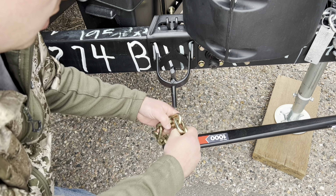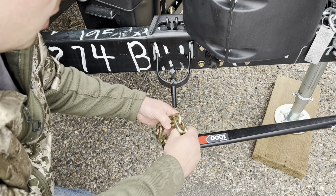Anytime you're transitioning across the hitch, make sure you're not going to rub against the little ball for the sway control or the greased ball on the hitch. We're going to go ahead and lower this down to riding height. You can see the truck levels out nicely. One thing to do before you start is measure the distance between the wheel and the fender with a tape measure, and then after setup remeasure to see if it changed. If you're around an inch and a half difference you're probably good. Any more than that, look at readjusting your hitch angle. If the truck raises up in front more than an inch and a half, check it; if it doesn't, you should be good to go.